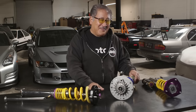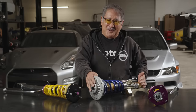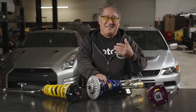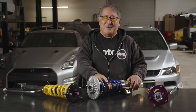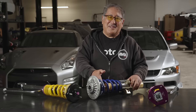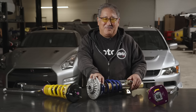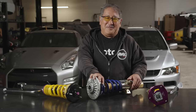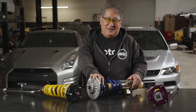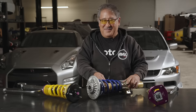As far as your shocks are concerned, the biggest thing is when you make your car low, you don't have much wheel travel. Almost all coilovers are designed to be lower — the bodies are shorter — but people always go that extra bit and end up messing things up. What happens is you run out of travel and you're running very close to the bump stop. This doesn't ride very well; the car doesn't handle bumps. Under the loads of cornering, when the car rolls, squats, or nosedives under braking, the bump stop touches down and the shock bottoms out.